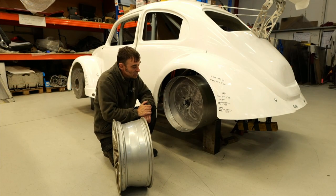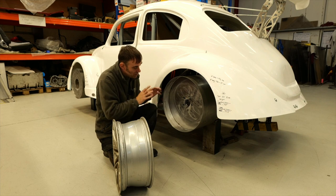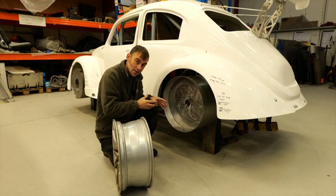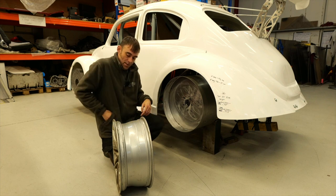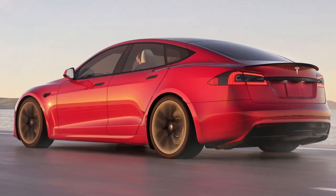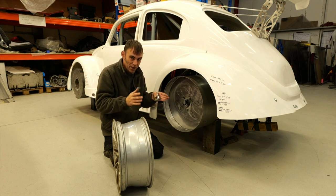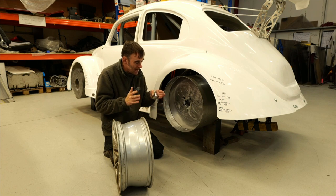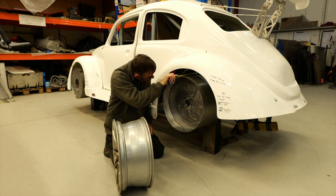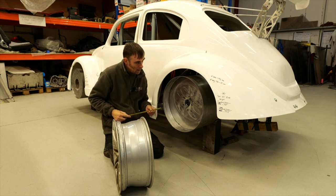Let's talk about wheels first. These are not the wheels we're going to use - these are mock-ups. What we're actually doing is figuring out whether the wheel size we want will even fit in there, and if it does, what the offset needs to be. A Tesla Model S Plaid has 10.5 inch wide wheels on the rear and 9.5 inch on the front. This vehicle weighs half the weight of that car but we still want to get that traction down, so I'm aiming for a 10 inch wide wheel on the rear. We need to make sure it doesn't interfere with the strut inside and doesn't protrude too much from the outside of the wing. Conclusion: it fits.